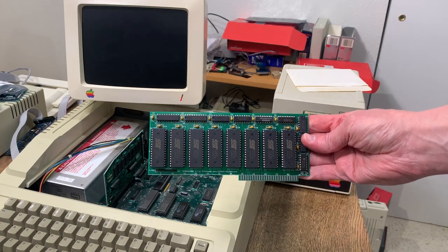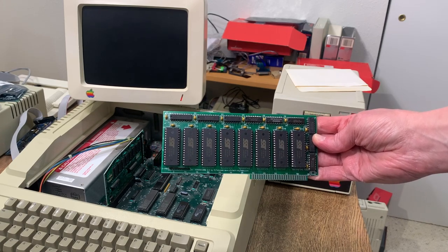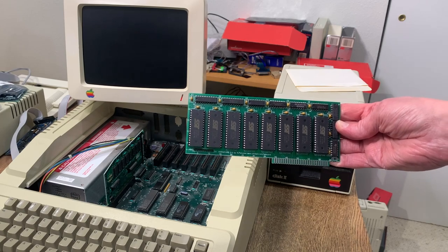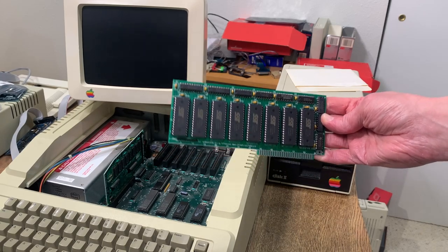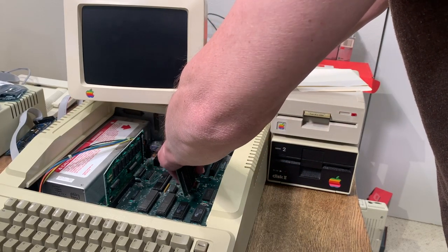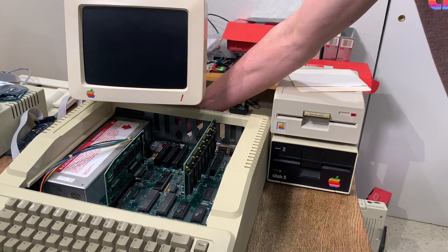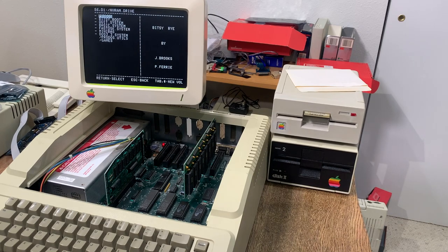The last item is the four megabyte NV RAM card from Raleigh Polovev. This card lets you boot up the Apple II almost instantly into a RAM card. Raleigh has been working on this for a long time and has finally gotten it to four megabytes of RAM — and it's actually readable and writable. I can put it in any slot I want; if I put it in a slot higher than my disk card, it'll boot this card first. With no other cards present, I've put it in slot six.